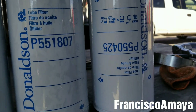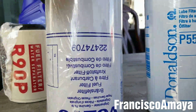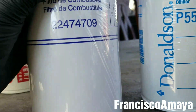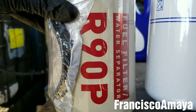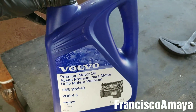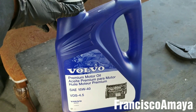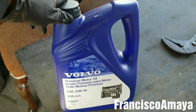You can also buy Volvo filters, which are fine — they're the same quality. We have the fuel filter right here; this is the part number of the fuel filter. And we have the fuel water separator over here. These are the four filters you need to do the oil change. Also, for the oil, in this case I want to be using OEM oil just to meet the specifications of the manufacturer.